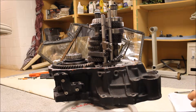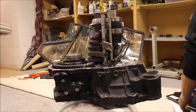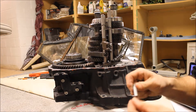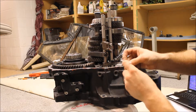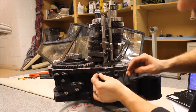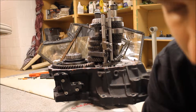Now we're going to install these balls. It's just an outer shell and there's a spring in the middle — the ball fits on the inside. So you put the ball in, put this in — that's for the open side, because there's a closed side and an open side for the ball. And these go in those grooves in the shifter.